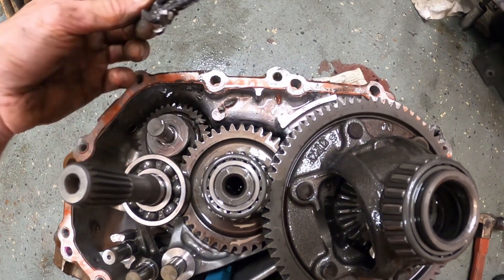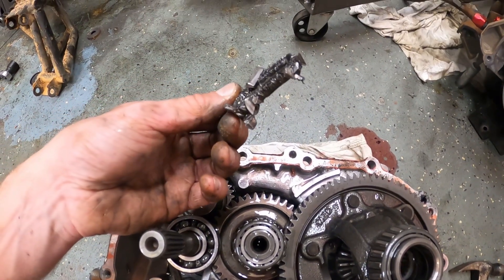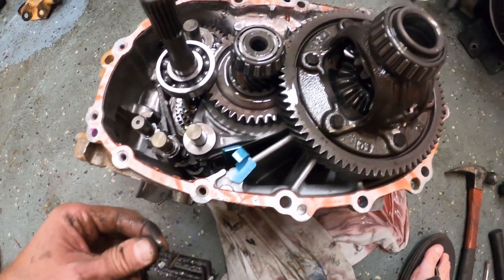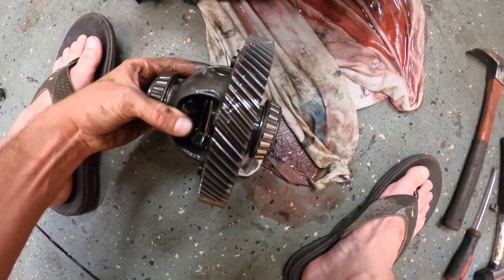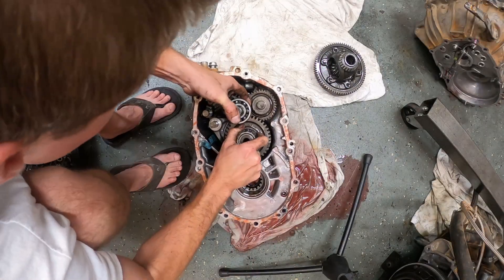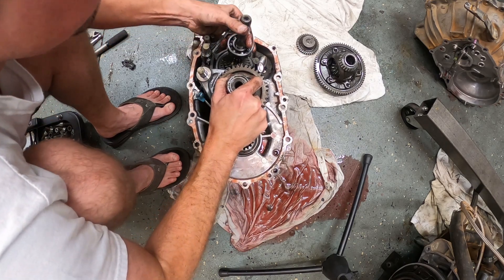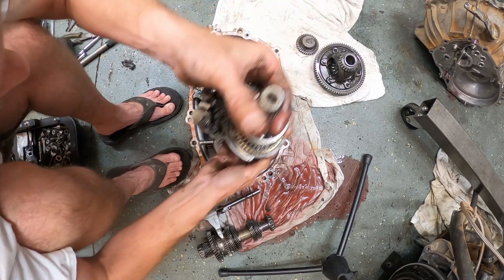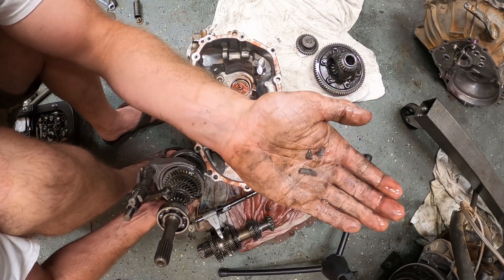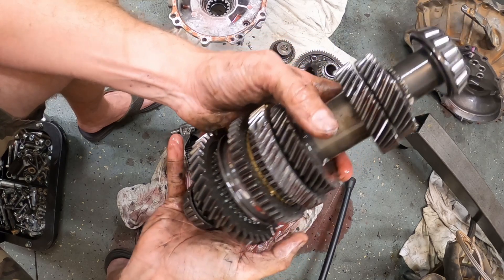I guess that's just a magnet meant to catch shavings, but we're definitely down a few teeth — because those are definitely gear teeth. The question is, did we blow up just one gear? Let's keep digging. There's only some chunks down in the bottom — those look like teeth. Oh look at that — we cleaned house, boys. We cleaned house.